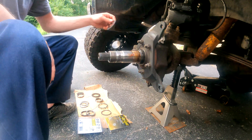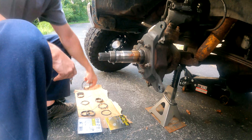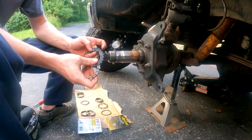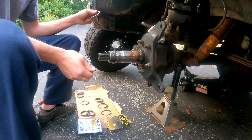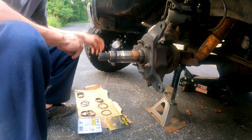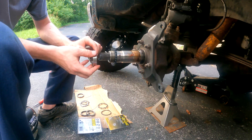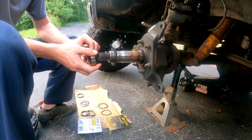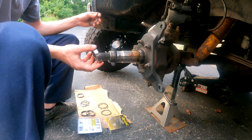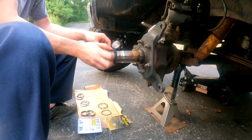On the Stage 8 five-piece design, a thrust washer goes on first against your bearing. Then you have a notched washer which replaces your original retaining washer — both are keyed for the spindle. The original has a bunch of holes for the pin; the new one has a bunch of notches for a locking retainer. Then you have a grooved spindle nut with two grooves in it for a snap ring and notches for the retaining piece — that replaces your original pinned spindle nut and sets your bearing preload the same way.